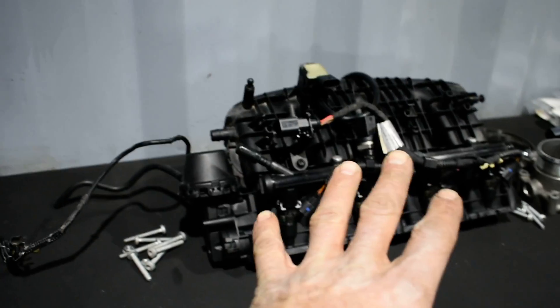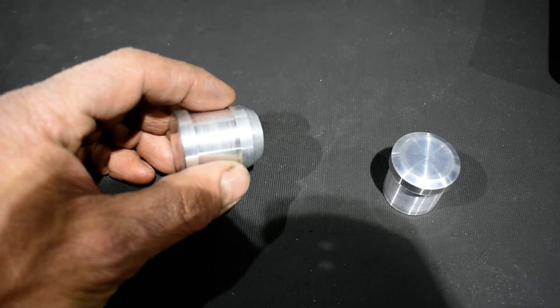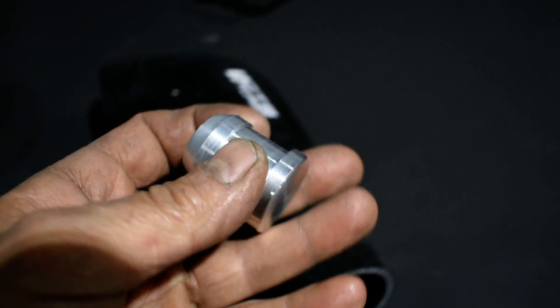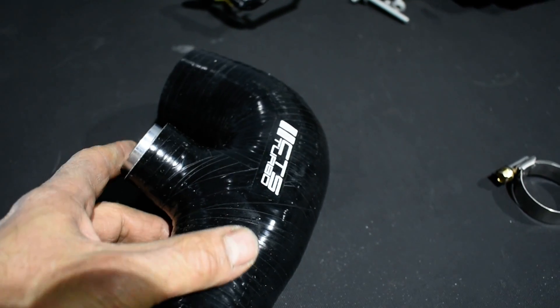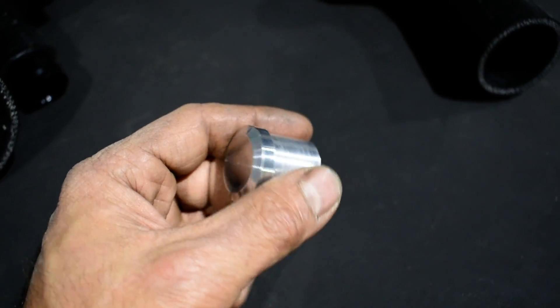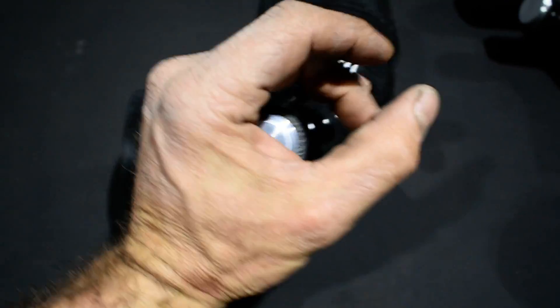I fixed this on a lathe machine. This is for the charge pipe — it comes here and has a lip here and here so it doesn't escape. In the middle you'll use a hose clamp to tie it. You end up like that. The hose clamp secures it because you're running without a bypass valve or blow-off valve. This one without a lip — because it does have pressure, and it's only shaking. This is for the turbo and it's going to come here, like that, also secured with one hose clamp.